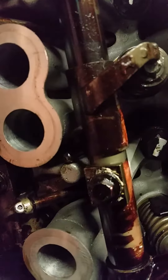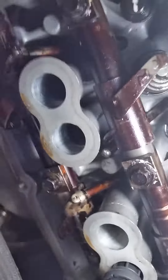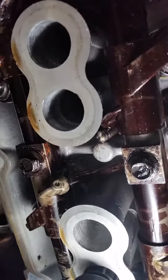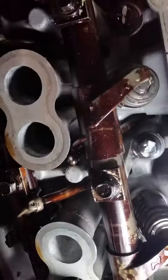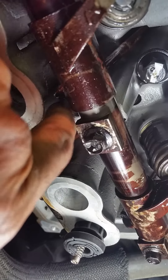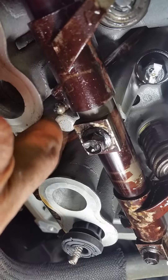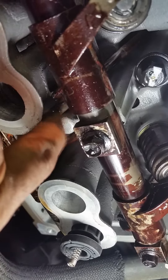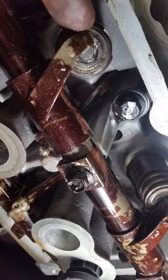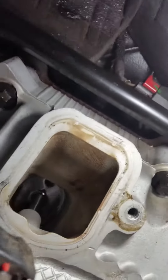I'm going to get a little more light on it so we can see it better. There you see it — you can see the top of the head of the push rod right here. You see that? When the motor's running, that's going to be moving up and around and that's going to make a heck of a noise in the car. But what it's not going to do is activate this valve. With this valve not activated, what's going to happen is fuel is going to pile up into the intake, as it's done here.